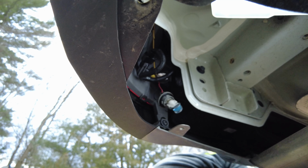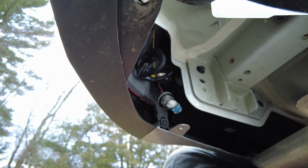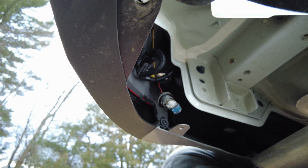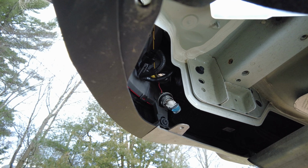Alright, we got the bulb on. I'm gonna go put it in reverse, see if it lights up. It's always good to make sure that you test anything before you fasten it all back together. Just test it, make sure that it's all right, because sometimes LEDs have only one direction. It'd be a shame to have all this stuff buttoned back up to find out that you have the bulb inserted the wrong way. So, let's test it. Guys, let me know when the light turns on.